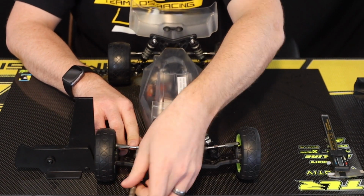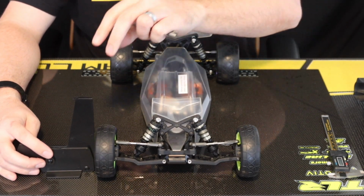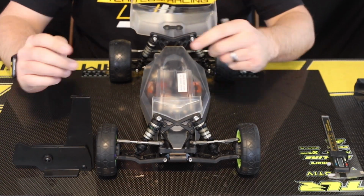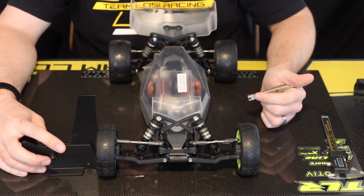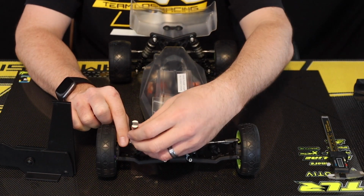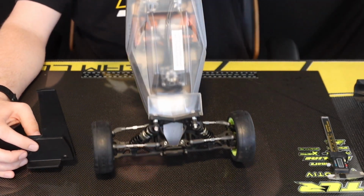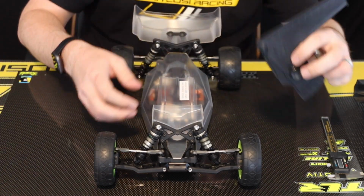We're just gonna go a quarter turn at a time and give it a little roll and line this guy up. And then I'm gonna do it again. What I wanna do is check multiple parts around the diameter of the tire, because they're not always gonna be perfectly round and you wanna get a good average. So that quarter turn was a smidge too much. I'm gonna go back out like an eighth turn, and I think we're gonna be pretty good here. Yep,